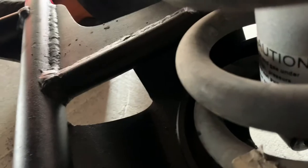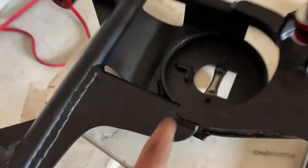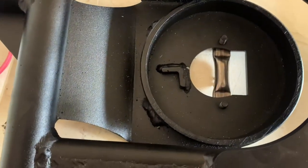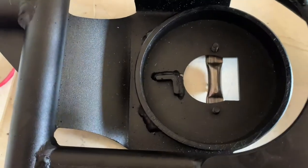Really quick - I put the spring back on the new DJM lower control arm. There's actually a notch where the bottom of the spring will sit. It's very important that you have your spring orientated correctly. You can spin the spring, but there's actually a little pocket - your spring will spin and spin and once it hits that pocket, that's how you know it's seated correctly before you continue putting everything back together. The last thing you want is your spring not seated correctly and starting to make noise.